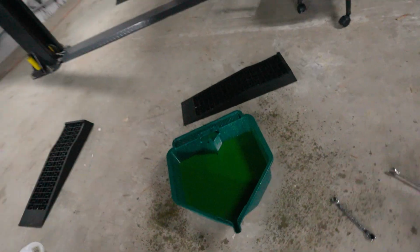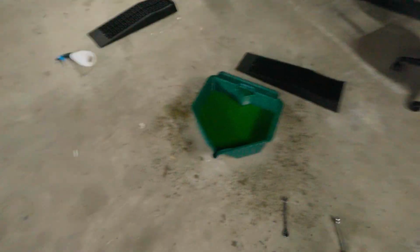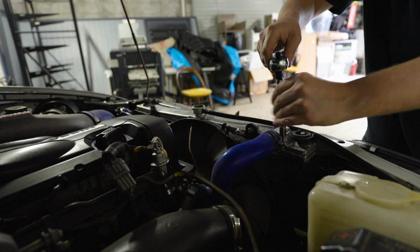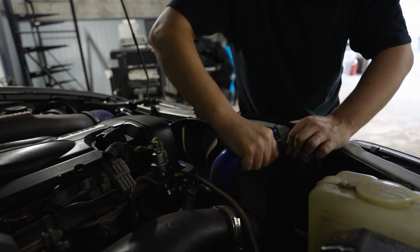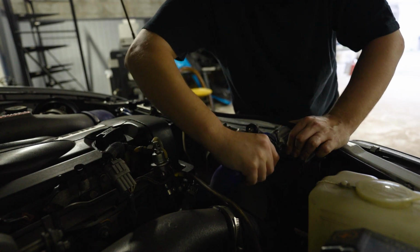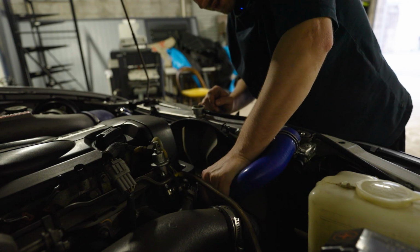All right, so the coolant has finished draining. I'm gonna lower it down and try and get the top hose off first. Up here, we will do that and replace that. Let's get it done. I believe the top hose clamp should be at 10 mil. Beginning to think it might even be leaking from the top one, to be honest. Maybe, we'll see. Another bolt here. One thing with these hoses, they're gonna be heated and cooled a lot. So you'll find that they're pretty much seized or stuck on for the most part, but this one's coming off pretty well, thankfully. Taking off the thermostat end side.